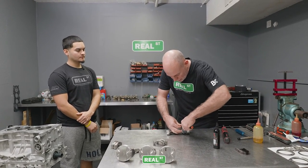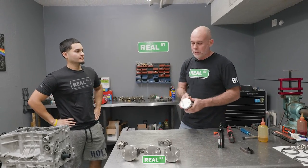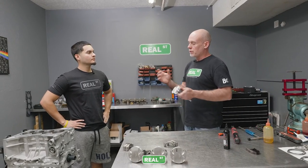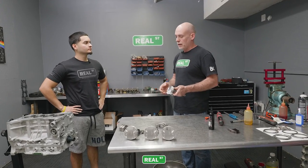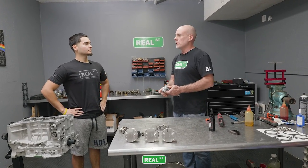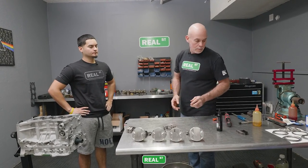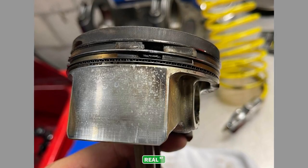Like when you had this engine in your car before and you were just getting it sorted, there were some fuel delivery issues with how the basket interacted with the fuel pump and with the fuel level, and the engine was run low on fuel a couple times. Things like that, a 2618 piston is more likely to let you get away with, whereas an OEM piston is more prone to cracking. So this is just a stronger forging.